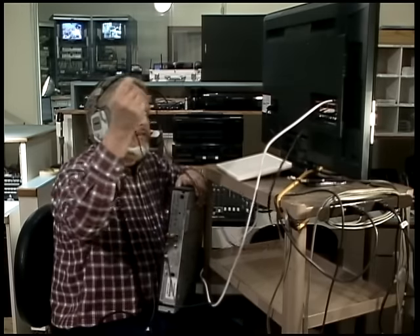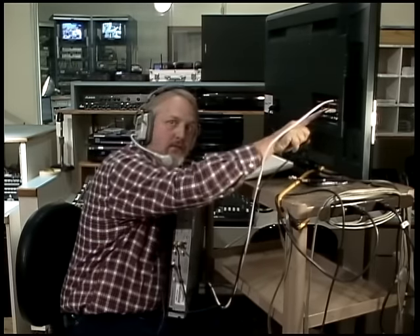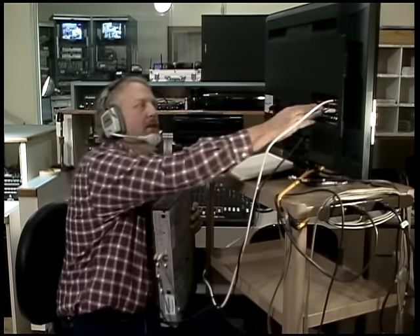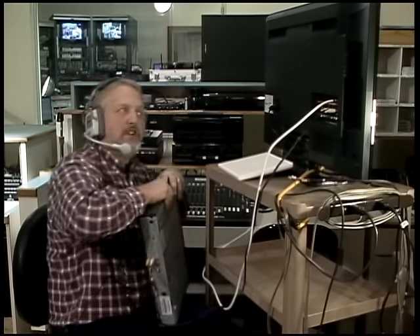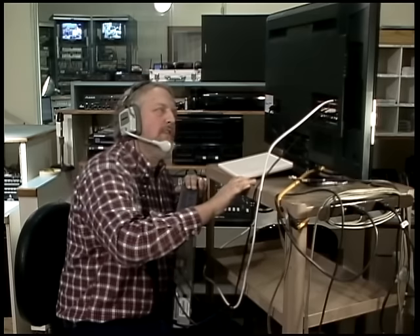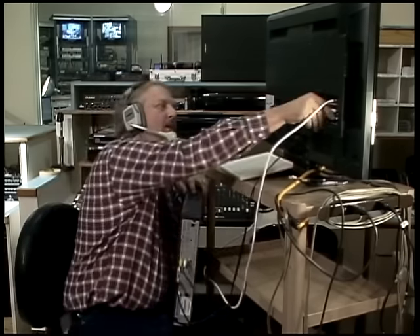You come out via the audio and video cable into the television set. So in this case you switch between audio/video and the TV. To receive satellite, it comes through on your audio and video input; you pick up your satellite receiver remote and change channels. Then your television remote — with its built-in tuner — lets you switch back to TV mode to tune local channels. You'd have two remotes, which is a drawback, unless you have a four-in-one remote you can program to do both functions.